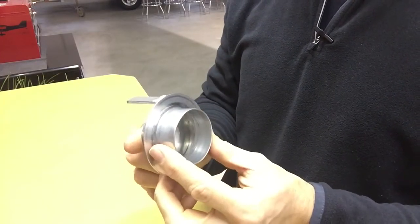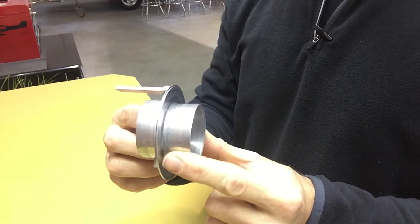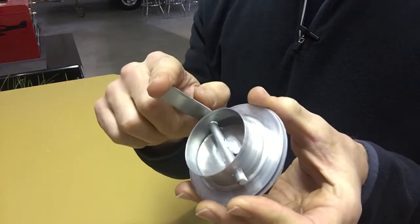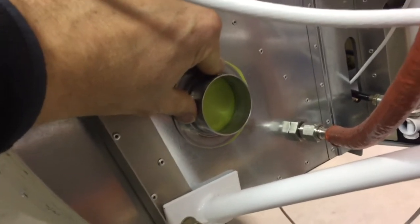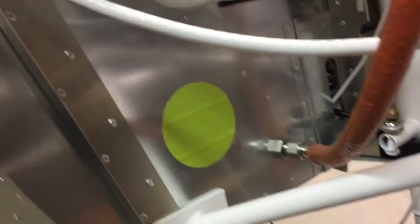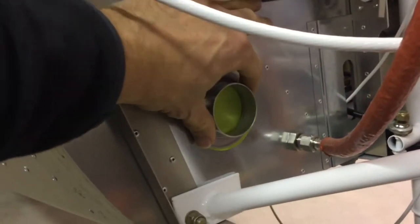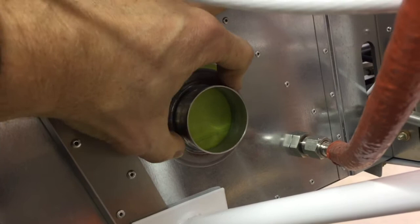With that said, I'll show you a little bit on the hangar and then I'll show you what I did on the airplane. The other thing I'm working on is I need to get this cabin heat installed. Zenith provides these two parts right here, and they get put together like this with a firewall in between them. On the cockpit side, we have this little butterfly valve, and that just turns the cabin heat on and off. On this side of the firewall, I put just a piece of green masking tape where this piece is going to go, just to remind me when I'm routing battery cables and fuel lines and stuff like that to leave this open. So basically this just gets riveted on here with the other butterfly valve part on the other side, and then the hose will go from here up to the muffler.